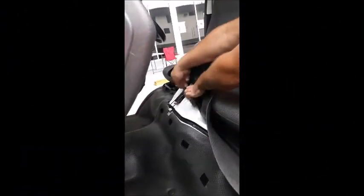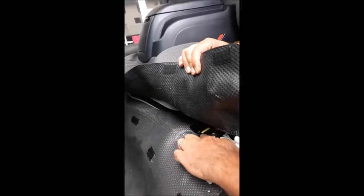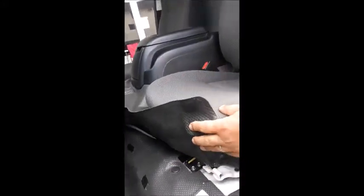To access the engine bay under the passenger seat lift up the flap and release the clip. Then push the yellow lever towards the driver's seat. You will hear a click. Next bring the passenger seat forward. Lift the seat and secure it with the strap inside of the passenger pillar.